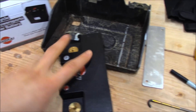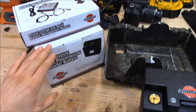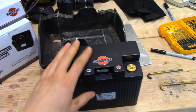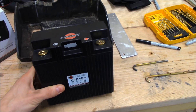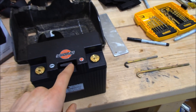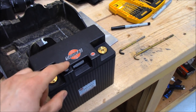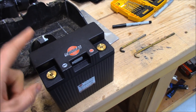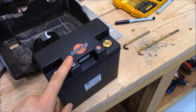I'm going with a lightweight battery option — a unit made by Shorai. It's rather small, only weighs five pounds, and looks like something that would belong in a Power Wheels. It is the largest, most powerful unit they offer. I paid around $250 on Amazon. It has 540-560 cold cranking amps, which should be enough to run the RX8. I've read reports of NSX owners using this, and a personal friend uses it in his Toyota MR2 Spider with good results.